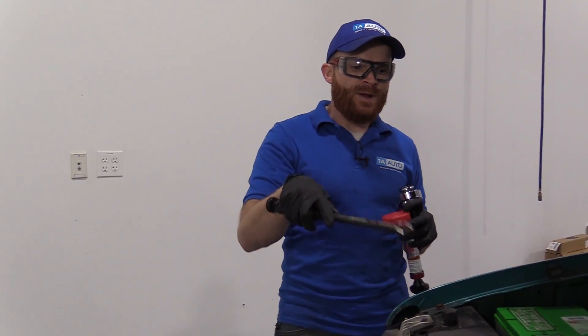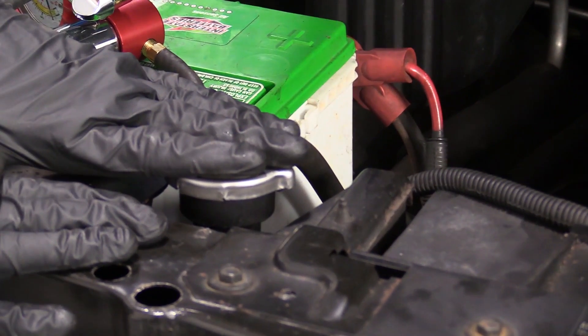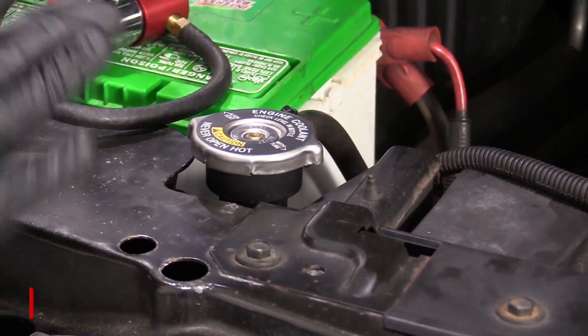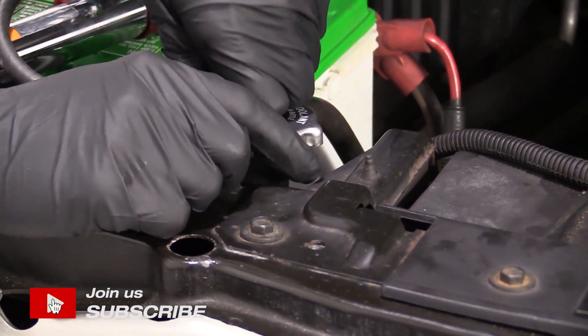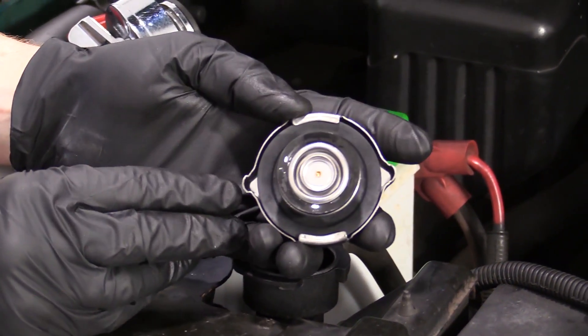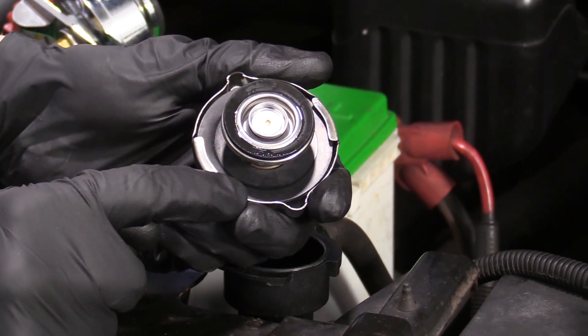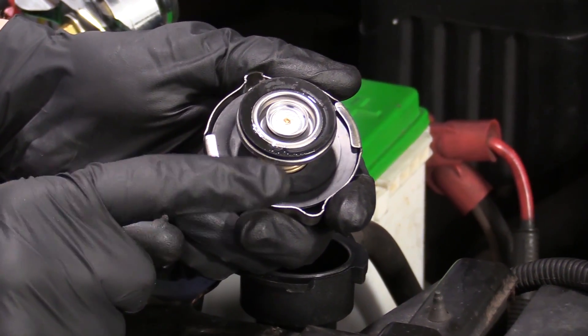You're only going to need a little bit of safety gear and some simple tools. Feel your radiator cap — if it feels hot, you don't want to open it yet. Assuming it's cold, press down, turn to the left, and open it away from your face. Take a look at the radiator cap and make sure the seal looks good. If the seal is dry rotted and cracked, it needs to be replaced.